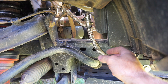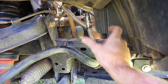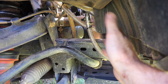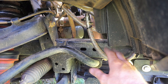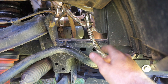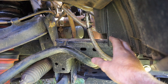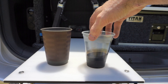One thing I've noticed with the drain hoses on the Provent 200 — you can buy a kit that puts a little reservoir in the line, allowing you to catch a lot more oil. That would let you almost leave it to 10,000 k's between service intervals and just drain it at each service, which would be quite good. Maybe down the track I'll look at doing that. For now, with the Provent 200 doing its job so well, you really need to check and drain it about every 5,000 k's.